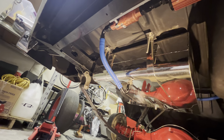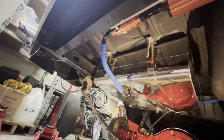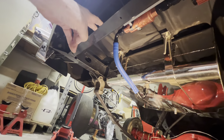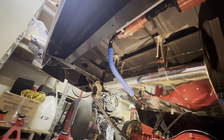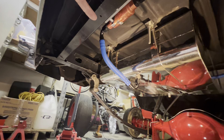This is my frame. It's a Daytona frame — it is one piece. I want to support the idea of anybody who wants to powder coat anything. This was powder coated probably 50 years ago also. First they dipped it, then they blasted it, then the interior of the frame was primed. Of course the outside too — then primed and powder coated the black. It's held up really nice.